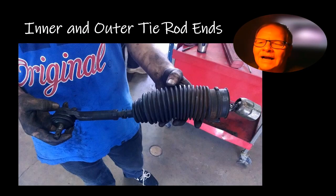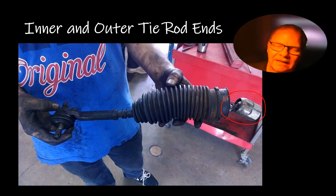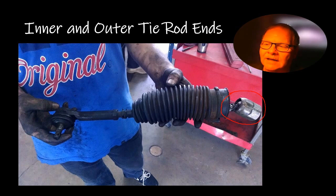These are inner and outer tie rod ends. The inner tie rod ends on a rack are bad to wear out — you have to screw them off the end of the rack, and sometimes there's Loctite on there so you need to heat them up a little to melt it. There are special tools made for that; I took a 1-5/16 inch wrench, a big cheap one, and bent it so I could stick it up in there and use a pry bar in the box end to break one loose on a Taurus. The tie rod end wears out and gets loose in the ball socket.